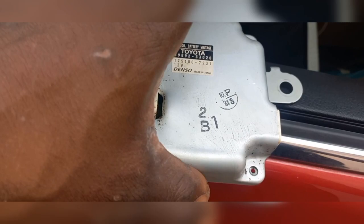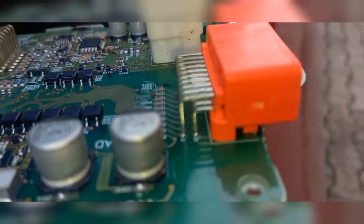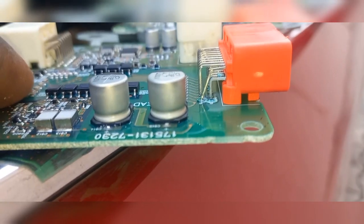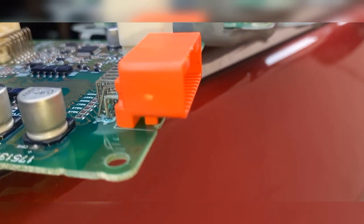This is another smart unit that I just got and I've already opened it up. In comparison, this is the new — actually a used one that I just got. You can see how the voltage terminals are all straight and set compared to this one here, which is protruding. This one is not straight — it's corroded and even contacting this other leg here. Watch this one here — this one is all clean and set. So that's the problem. I believe replacing this here would fix the code and we'll be good to go.